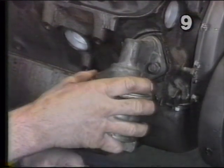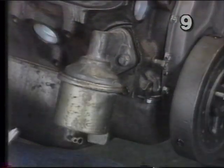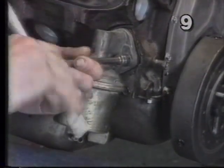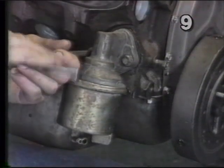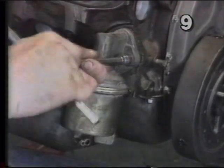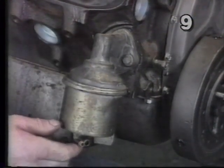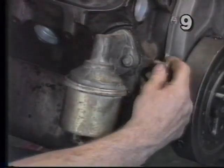At this point, I've actually contacted the fuel pump rod but I still have about a quarter of an inch gap between the pump and the mounting plate. Now we can take our wrench and, by alternately drawing these bolts in, we'll pull the fuel pump in with them, keeping proper alignment to the fuel pump rod and the block, and compress the spring in the pump until the pump is seated snugly against the block. These bolts can be brought up to approximately 25 pounds, which is just a little bit less than what we tightened our intake manifold to. We've successfully installed our fuel pump with the least amount of effort. Do not forget to remove the bolt that we used to hold the pump rod in place.